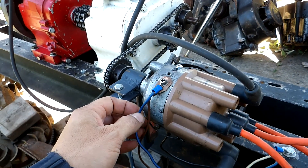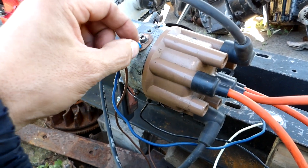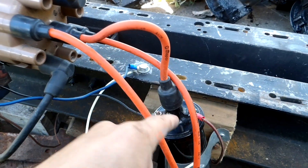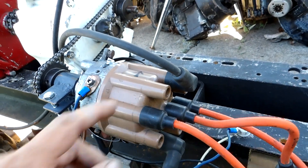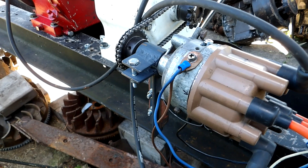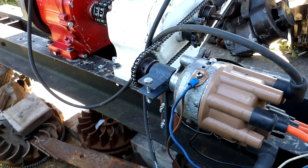That's just an improvement I made over the years after getting zapped a number of times. It's a pretty simple circuit — feeds into the positive side of the coil, then out into the distributor, through the points. They open and close it, which causes the spark in the secondary side of the coil, which leads to your central distributor wire. Then it gets distributed by the rotor out to the various cylinders. Pretty simple system — absolutely zero electronics. You know me, I like that type of thing.